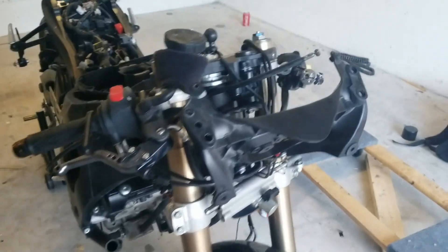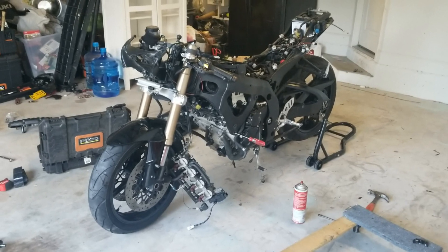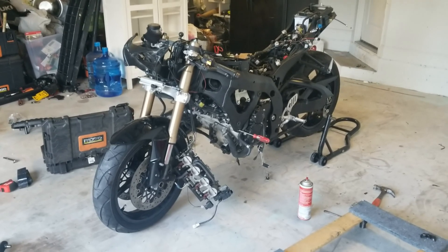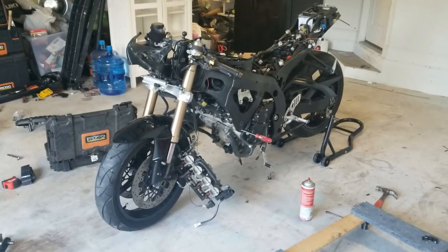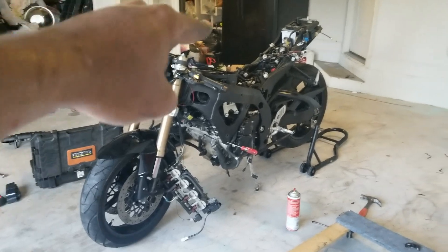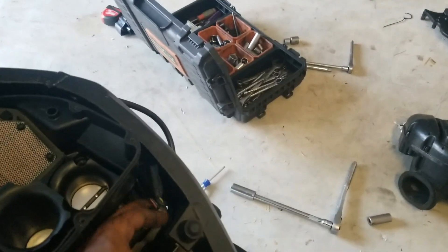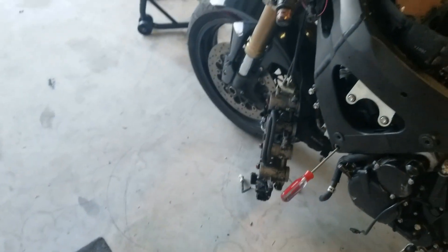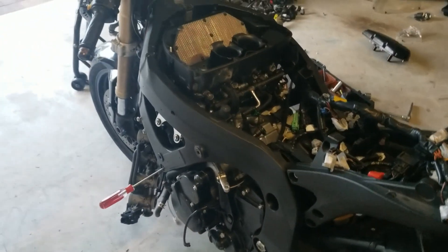What I'm thinking I'm going to do is get a 2009 750 throttle body and put that on this 2011 750 motor. The motor doesn't seem that different — it seems like they made most of the changes in the throttle bodies and the intake. What that will allow me to do is not only have this lined up, but the actual plug on the 2011 throttle body is different from the one on the 09, so I'm hoping that lets me keep this wiring harness.